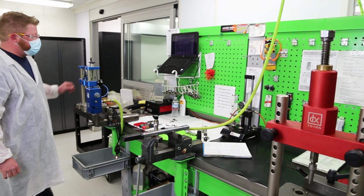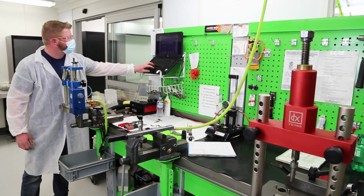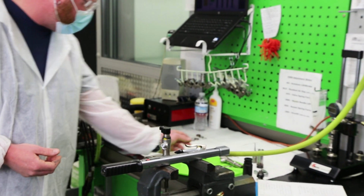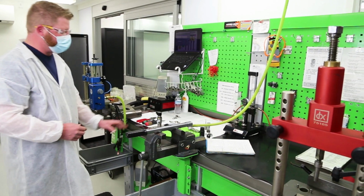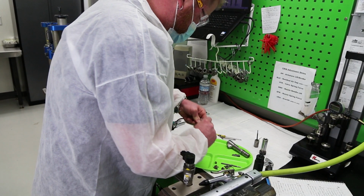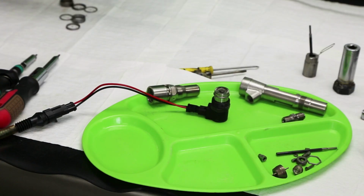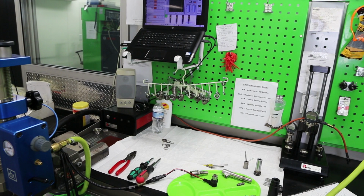And the computer program here tests my piezo stack. These 7007s, 6.4 liter, are piezo. So they have a piezo stack. And this computer here will test that piezo. Press enable burst to perform average energy and loss energy measurement. I can repolarize it and then energy burst. Repolarize the piezo at 130 volts.